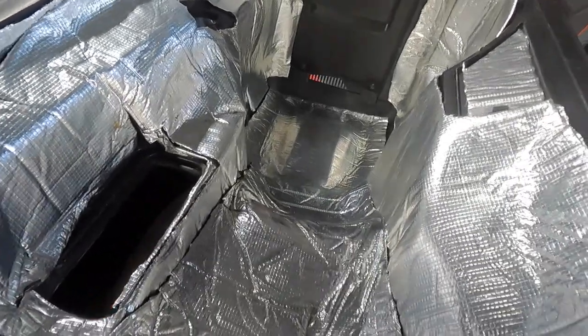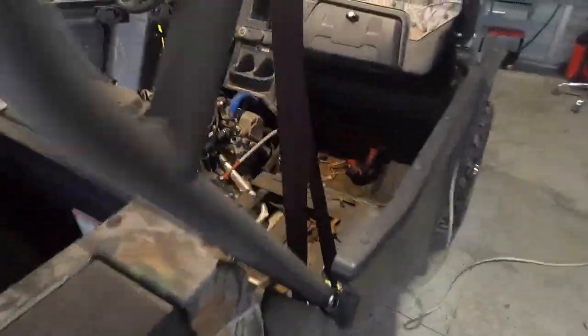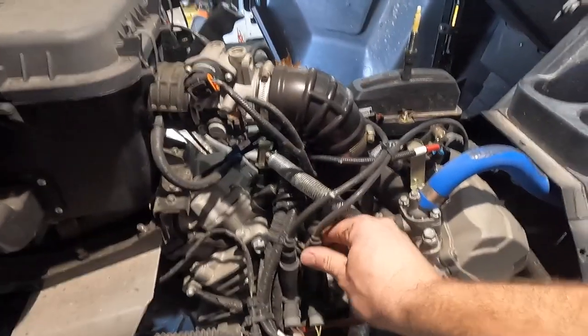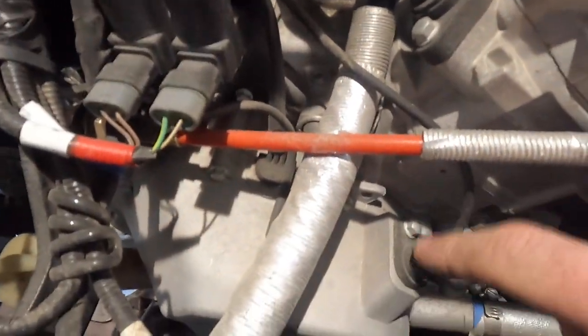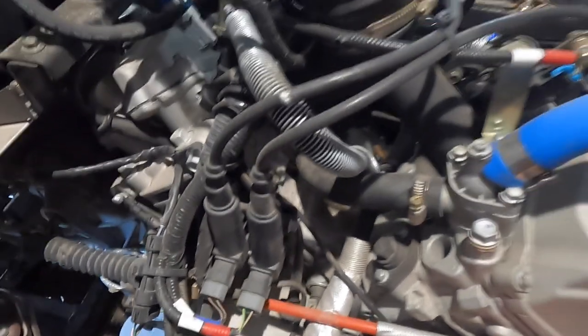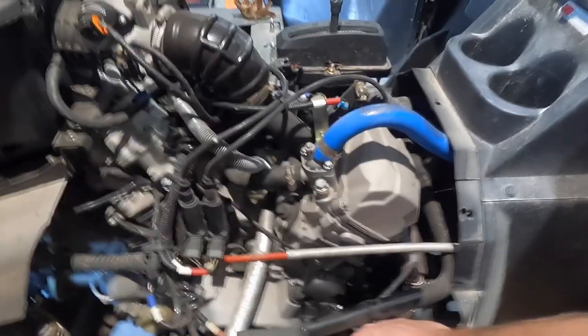Let's get back in here to the cab and take a look. There's the intake for air, here's your front cylinder coil, rear cylinder coil — very easy to get to. All the way down here you have your gear position — what they call an angle rotation sensor — that shows your gear positions. This here is your crank trigger; it basically tells your ECU when to tell the coils to fire off on which cylinder. The oil filter is on the front, right down here, with 3/8-inch head 6x1.0 bolts.